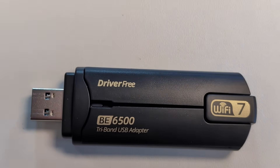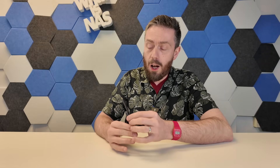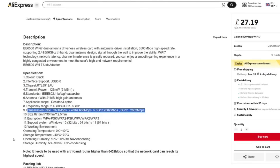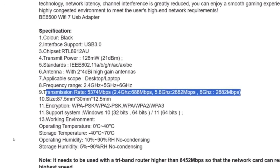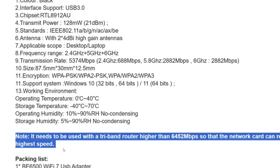You may have noticed this device is listed as BE6500 — that's because it claims to handle a full bandwidth across all channels of 6.5 gigabits per second. Some other USB Wi-Fi 7 adapters I've seen claim 5.8 gigabits per second. Wi-Fi 7's multi-handling of individual data connections at 160 and 320 megahertz does give some credence to that, but as this is a two-antenna tri-band adapter, I struggle to see how most users — at least in the next decade — are going to enjoy 6.5 gigabits per second as straightforwardly as this adapter claims.